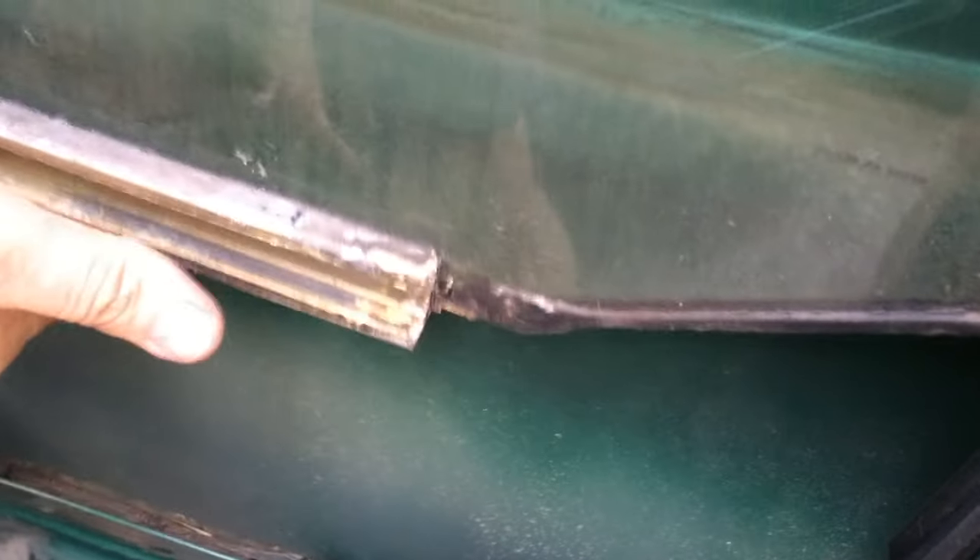Now we've got access here. If we come down here with a flashlight, you can see there's our guy we're trying to get at, but the glass is in the way. With this out of the way, we're going to end up having to pull the glass up so that we can get access to remove these bolts. There's a couple of 10 millimeter bolts here that are holding this. You've got to be real careful - this is going to be dangerous. I'm just going to hold this up with one hand. Here's the 10 millimeter bolt that's holding this, and then over to the back side is where the rod goes down and connects to the door lock assembly.